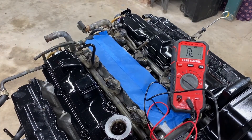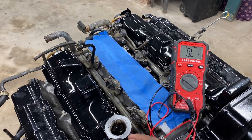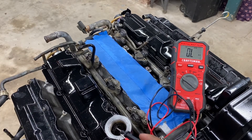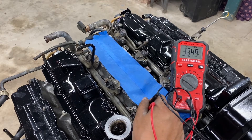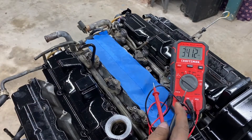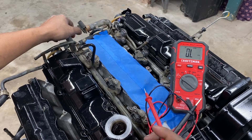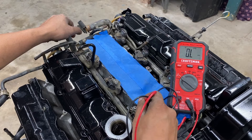Those three injectors on this side are bad — that's how you check the ohms. It should read 12 ohms. So we had three good ones on this side and three bad ones on this other side. That's why the car was not idling right and had a misfire on this cylinder. Now we know. I wish I had a battery here so you guys could hear the clicking noise when you put power on a good injector — it should make a little clicking noise.